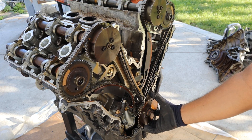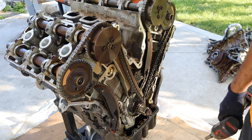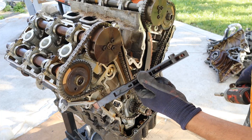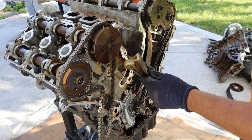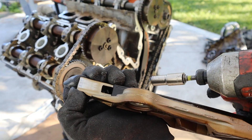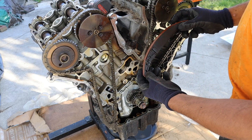This here is the trigger wheel for the crank position sensor. I'm going to start removing these chain tensioners. I'm going to remove this chain slide — it just has a pivot that it comes off of. Now this timing chain guide is made of plastic, and this one is made of die-cast aluminum but the actual slide part is also plastic. There is a bit of wear near the top here where it was grazing something.